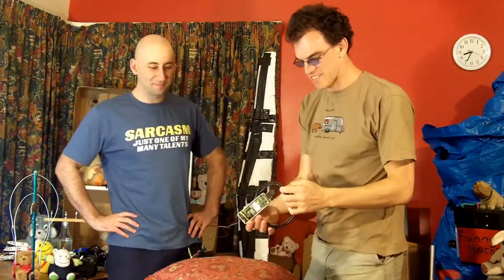A friend of mine had some trouble — she's got this new fancy phone, except when the battery gets too low, the phone is unable to boot up enough to be able to charge the battery. There's nothing you can do about it with the actual phone. So I took apart this donor phone. Because it has the same type of battery — same voltage, same number of pins, and they're all labelled the same.